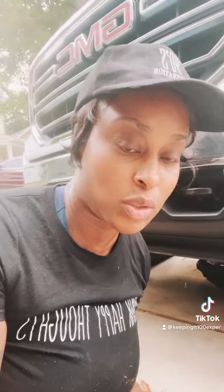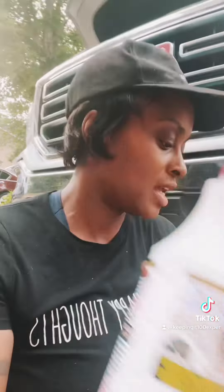I'm going to let this sit for about 10 to 15 minutes until I don't see anything dripping, because I try to let it drip to the last drop. This GMC Sierra 1500 SLE takes eight quarts, but if you're going to use an oil treatment, get seven quarts of oil plus your oil treatment.